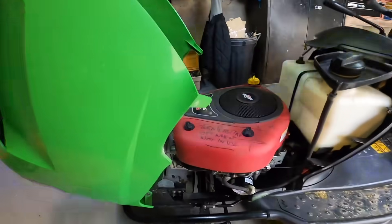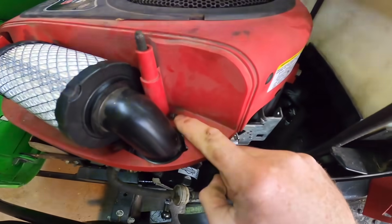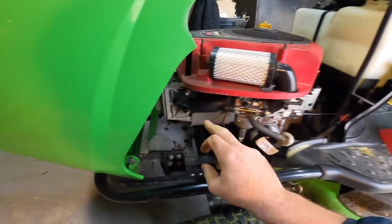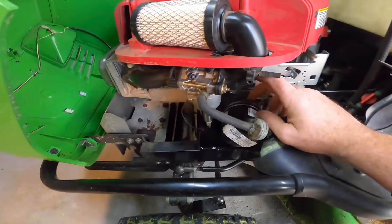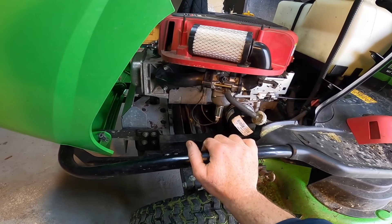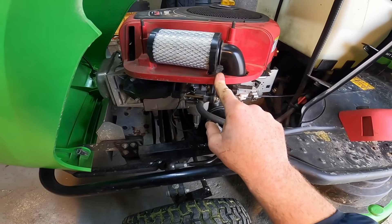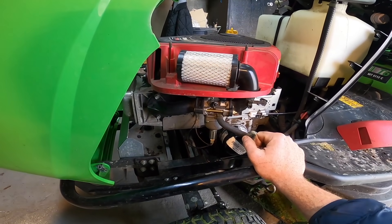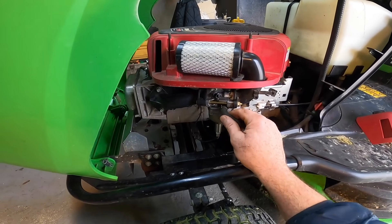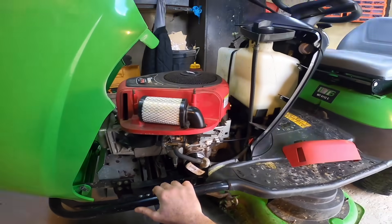I did do another little job on it as well. When the battery went, I removed this cover here. I put a new air filter on it, but when I was doing that I opened up this little screw here and these two studs, took off the fuel line and the air line, and removed the carburettor. The carburettor in these is very easy to work on — just be careful that you connect up all the throttle linkages back in the proper place. Take a picture before you take it apart. All I did was remove the sediment bowl, it was quite clean actually inside, but I ran some carburettor cleaning fluid through it and blew out all the jets with an air line. Put it back together again and that was the end of all the sputtering — it's lovely and smooth now.